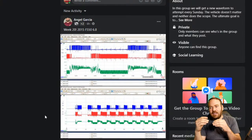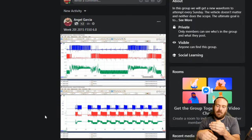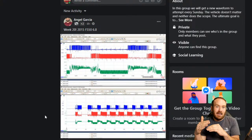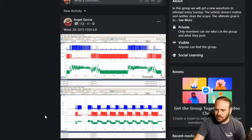And then if, say, our 5-volt reference was missing, that wire was cut or there was corrosion in the connector, we would drop all the way to ground. Well, since the computer's like, hey, we shouldn't be sitting at 0 volts, we should be seeing at least 0.5 volt, it's going to set a code for circuit short to ground or open. Either one, they could be open depending on the computer design.